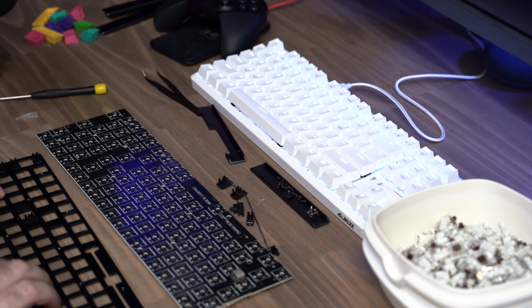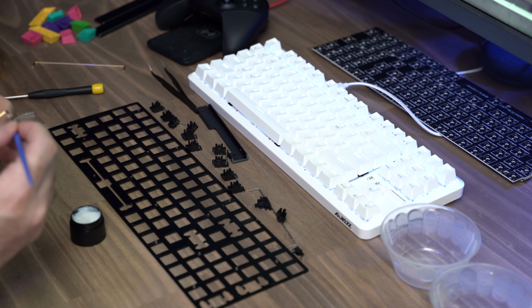which is very annoying. So one of the things that you can really do to fix the sound quality of a keyboard, just a simple one, is just lube the stabilizers. You don't even have to do the switches. That will make a massive difference to the sound quality of your board. I've just gone through and I've put all my new Durock V2 stabilizers on, and I've used the tape mod to make them a little bit more secure, and they have been hand lubed by me, so they should be ready to go. And now we're going to start with the switches.